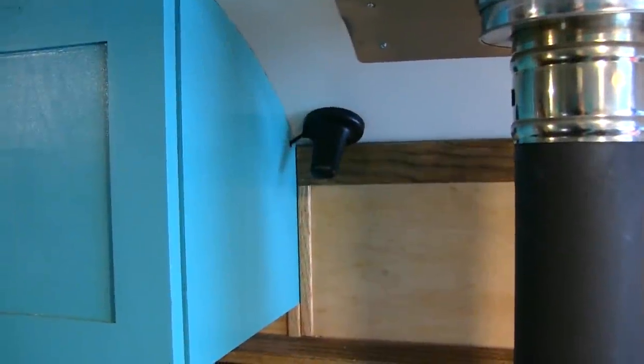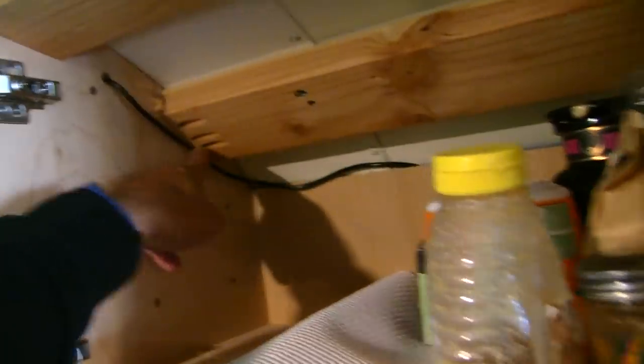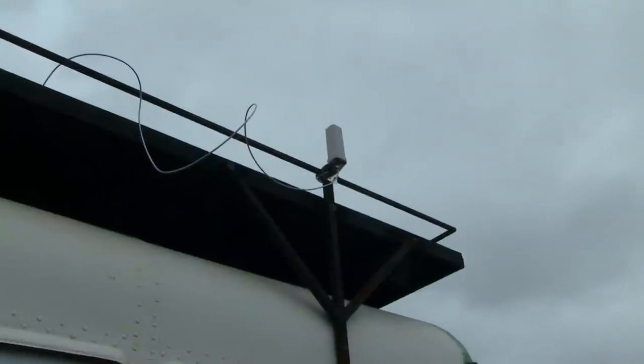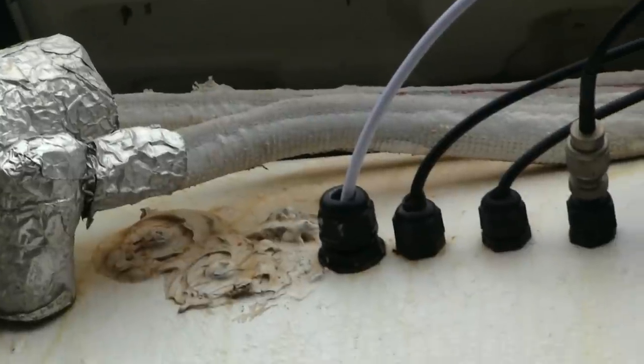Here's what I've come up with for the permanent install. I punched a small hole on the side of our cabinets, ran the cable across the back of the cabinets and through a hole there, behind some of my electrical stuff and gauges, and then it comes in to where I've mounted the internal antenna. The outside antenna is mounted right here on the roof — the wires aren't fully tidied up yet — it comes over and goes in through the cable gland and inside the bus.